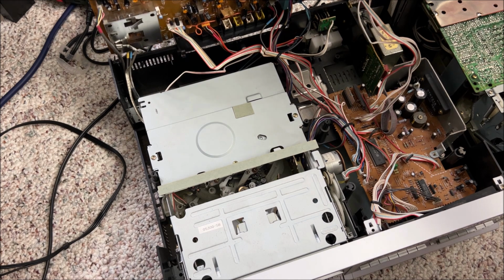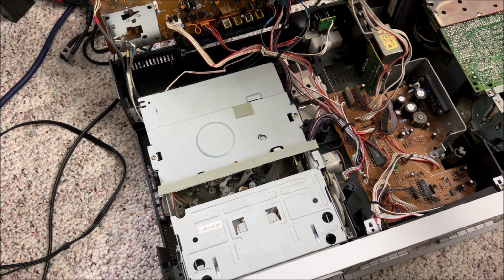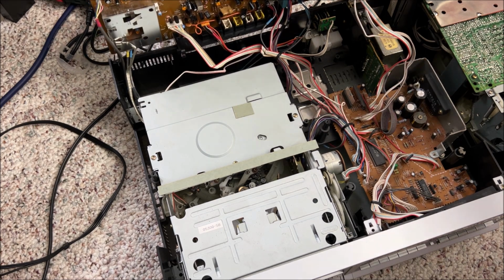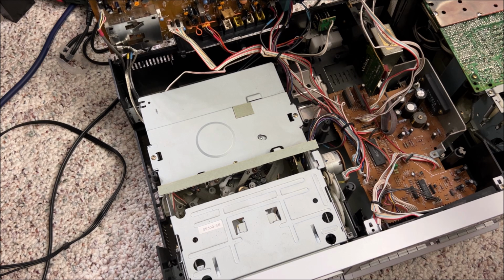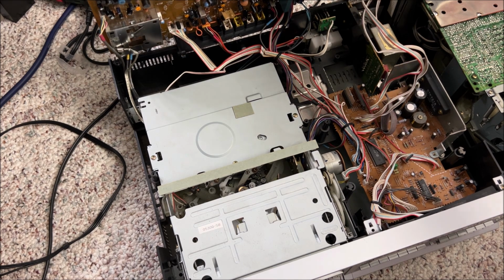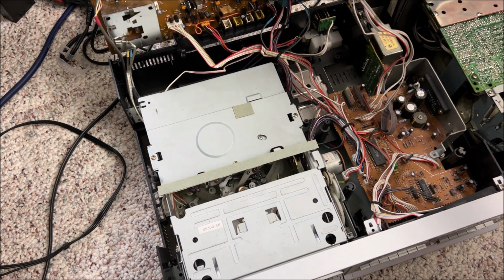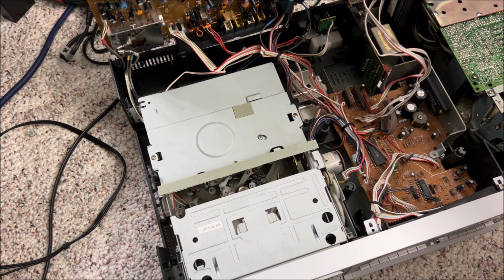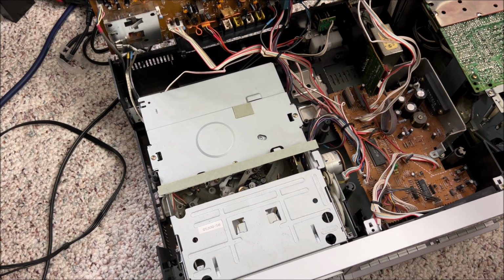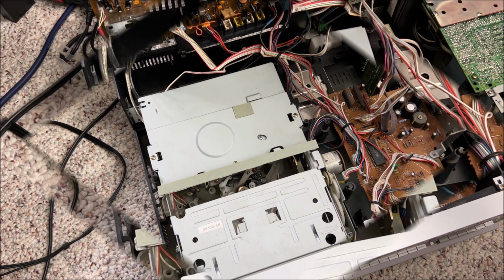And quite honestly, if you haven't noticed about me, I'm more of a VCR mechanic than I am an electrician. But the cool thing is, even though these VCRs are over 40 years old or approaching 40 years old, they don't require any caps to be replaced. So typically, the problems that you're going to experience with these are mechanical and dirt and the need for lubrication. And lubrication, I would say, is minimal. If something is struggling, you might want to lubricate it very lightly, but otherwise, lubrication is not really a necessity.